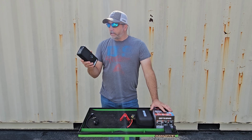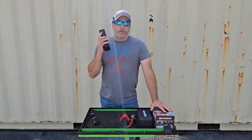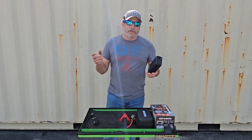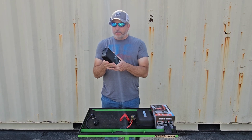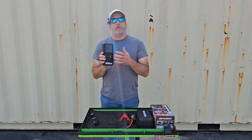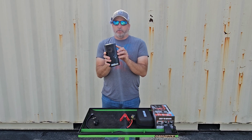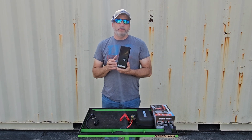Of course, obviously your main ones, which is what is it? Overtemp protection, overcharge protection, short circuit, reverse polarity, low temp, overload, over voltage, AI software, all that good stuff. It has all that. Another cool thing about this one is when you're jumpstarting a battery that's completely dead, on the side here you got a force start button. That's going to let you force start. Once you do that, you're missing some of your protections when you're trying to jump it.